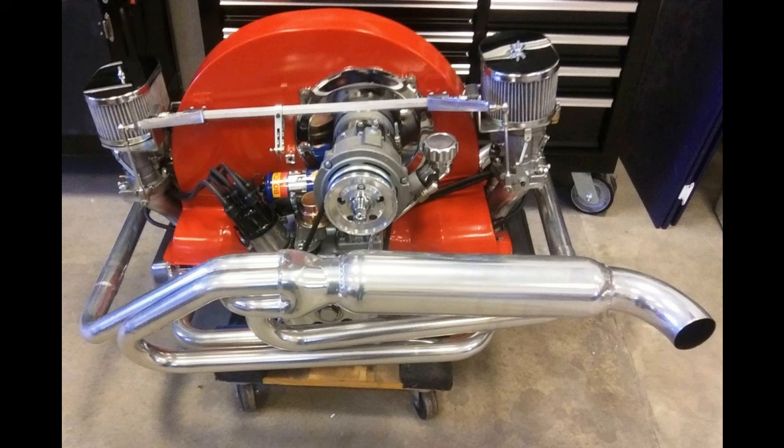The transmission is a Volkswagen 4-speed swing axle. It was professionally rebuilt and updated with new first and second gears, allowing the new style synchros to be installed. Anything that may have been out of order was repaired or replaced, including the nose cone and bushings. It shifts like it should. It has new — not rebuilt — pedals along with a shifter, shift rod, bushings and coupler. The original shifter was installed for appearance, though newer short shift models are far superior but not period correct. Axle bearings and bushings were also replaced along with the clutch arm, bushings and spring. The flywheel was turned and balanced, and a new throw-out bearing and clutch were installed.